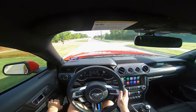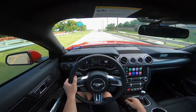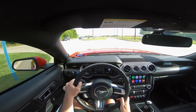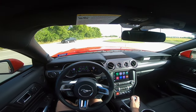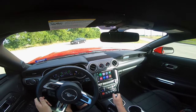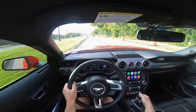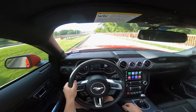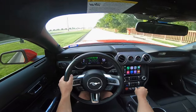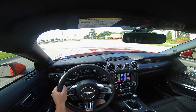All right, getting up to speed — I'm going to hit this U-turn right here and slow down so you can see what it does. I'm going to put it in third — revs it up — second. See, it had to rev it up pretty high at the end, then take it out of gear, let the clutch in, gears go back down. I'll show you a faster one here. You can see there — I was in third, just mashed it down into second, popped the RPMs up, and I was able to let off the clutch and mash the gas.